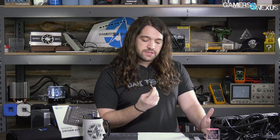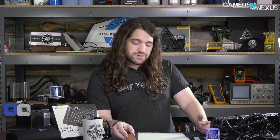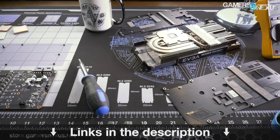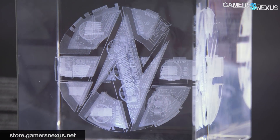You don't need to delid, and you definitely don't need the copper heatsink — neither is necessary to use the processor. But if you want extra headroom, it's worth it. The copper IHS is less impactful than delidding. Delidding isn't difficult — just apply liquid metal, reseal, and you're good. The IHS is 20 bucks if you want something more unique and a couple of extra degrees. Subscribe for more, and visit patreon.com/gamersnexus for mod mats or GN crystals.